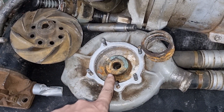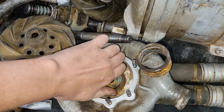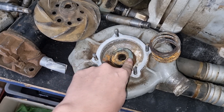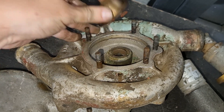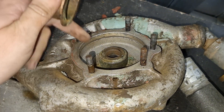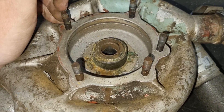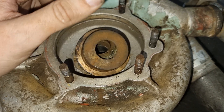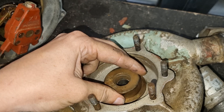Now, when your water pump fails, it is this. This is a brass sort of fitting that should spin in there quite nicely — kind of, but not really, like this one here. Underneath that — oh my god — it's a seal. That is what dries out, and that is the main problem on a lot of these. That's what dries out and that's what causes all the issues. These are crap; this is why we're not using them. This is completely cactus — not gonna work, and this one's even worse.